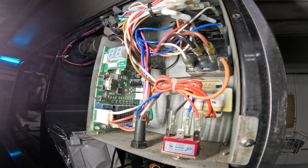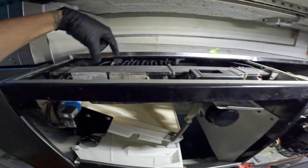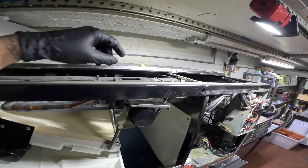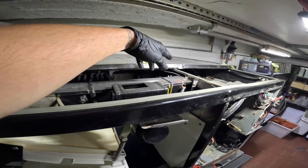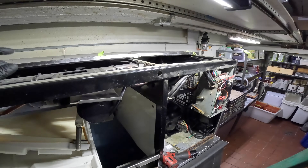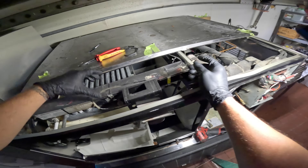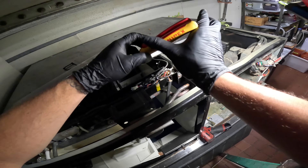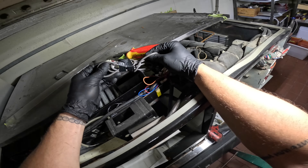Let's see which one is our bin control. I had to remove all the contents that were up top. Slide this down — there are wires going through here. If you follow that bin control, there's one gray wire. We've got to find a connection in here because the bin control connects with a Molex connector inside and then from there it gets connected to the board — it doesn't go directly to the board. This connector is right here.